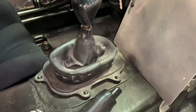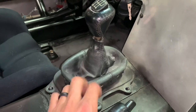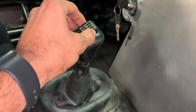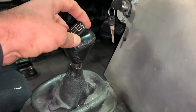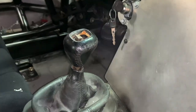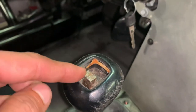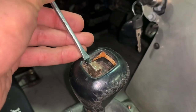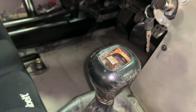I'm a little ways along. I've already got my 10 millimeter head nuts removed so I can get this thing pulled up and out. This isn't in there with any secrecy, it's just not super obvious — you just want to pry this up and out with a screwdriver or a plastic trim tool and it'll come right out. The only other thing holding it in is this little key, which I've already loosened up. You put one screwdriver on each side and pry it up, and you can just pull it out.